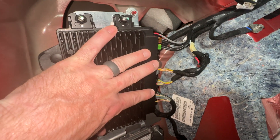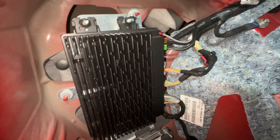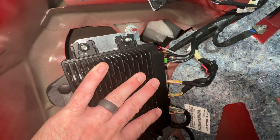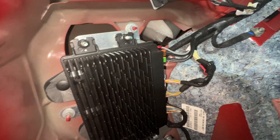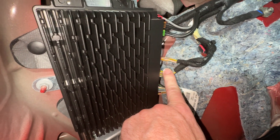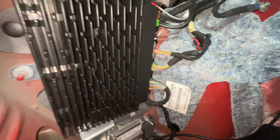So what this is, is the IPMA — the Image Processing Module A. The cameras come in on the fiber optic cables. This makes decisions and then sends commands out over the CAN bus to the steering wheel. And what we want to do is intercept those commands going to the steering wheel and inject our own commands from the Comma 3X.